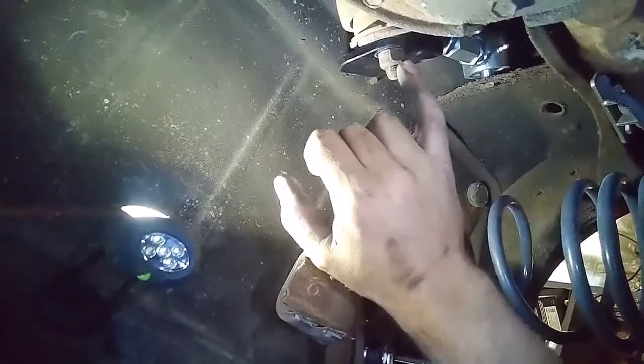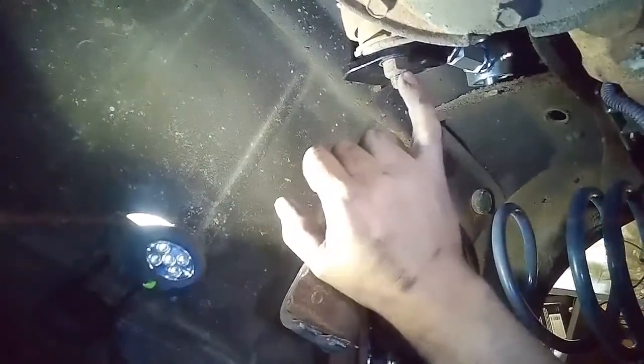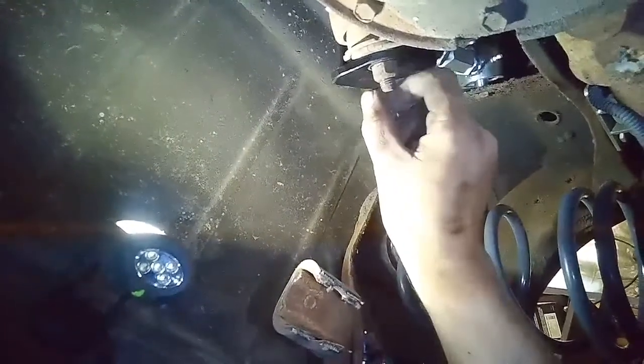So with that, I suppose it equates to like a nylock nut. It's kind of got an interference fit on the top end of the nut. So once you get the width of the nut onto the bolt, you start hitting resistance. So you're having to fight it from that far all the way up to tight. And it just was a pain. So I opted to use the impact.